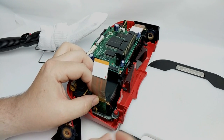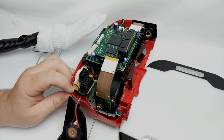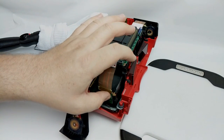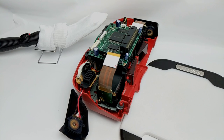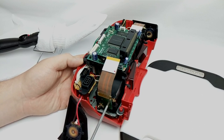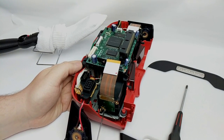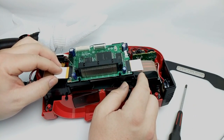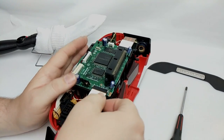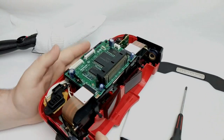So we're going to get everything lined up here. Grab our screwdriver — and always untighten first before starting to tighten your screw back into the boss; you don't want to recut these threads, you want to thread back into them. Do not tighten them down all the way until you have both screws installed, so you're sure you don't reinstall the lenses cocked at an angle. Just tighten them down until they stop turning. Slide this back into the connector, making sure we don't damage any other components on the board. You should see most of the orange disappear in the connector itself. Then put the speaker back and finish buttoning everything up.